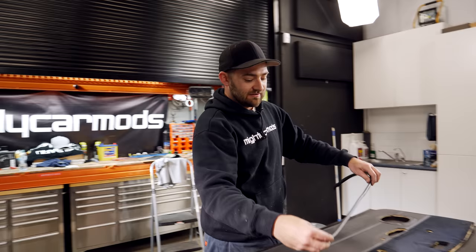The next step for our trims is to apply some pinch weld rubber that you can get from the hardware shop — it comes in many shapes and sizes and helps finish the top of the trim. While we've got the door apart, we're going to install some new plastic weather shielding inside the door. This stuff often gets more and more manky — the plastic rips and the glue hardens up. You can buy kits with enough product to do the whole car. Run the adhesive around the edge following the original lines, then lay the plastic sheet over the top of the door. Cut out any holes required for wiring, speakers, screws or door handles, then stick it down and trim off the excess. You can then use your heat gun to gently shrink the plastic, which will make it sit tight onto the door frame. Make sure the plastic's clear so you'll be able to see exactly what's behind it, which makes it easier to cut out the holes.